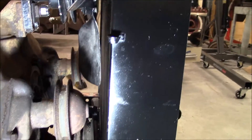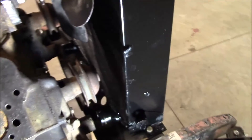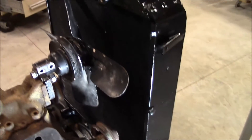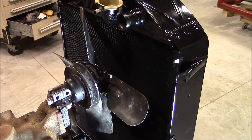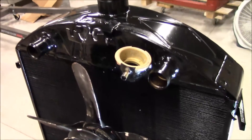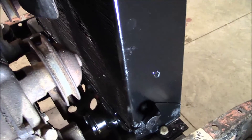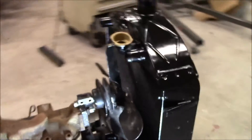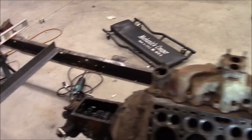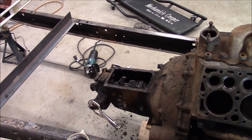I'm still going to have to figure out the bracket to put the generator on the head side so I can still have a generator. The Walker radiator was originally set up for a Model A — I got a great deal on it used — so I took it down to the radiator shop and had it modified for the flathead. He did a really nice job putting the inlets on the top and the outlets on the bottom, so that's going to work really well. I've also been working on the transmission cross member, but that's for another update. Thanks for watching — see ya!